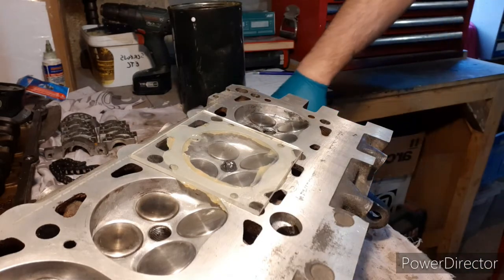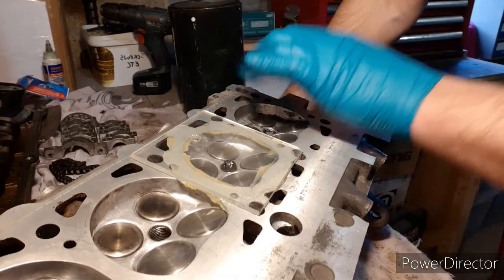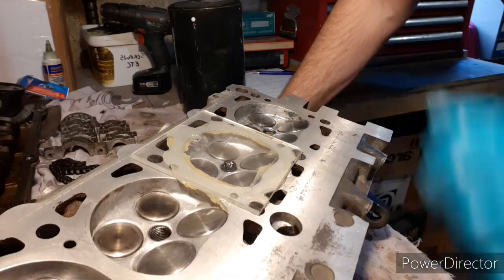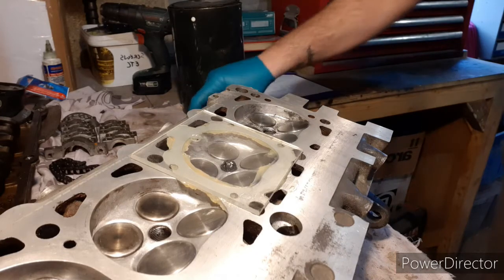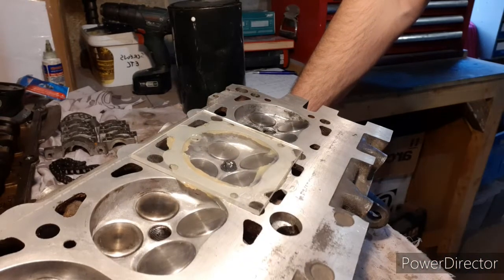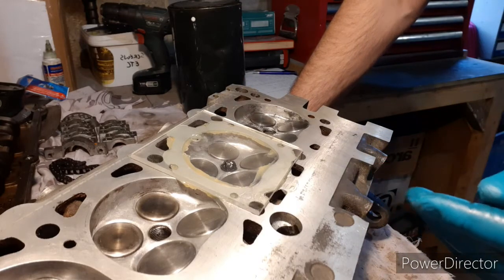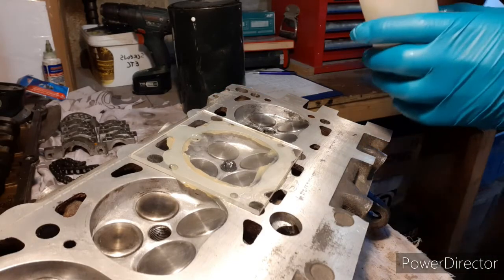That's now all sealed up. What we want to do now is put some fluid inside it. I've got the head at a slight angle with the spark plug hole at the highest point so that any air bubbles from the fluid can escape. I'm using some cleaning fluid with a bit of blue food colouring so I can see it — you can use screen wash which is easy enough. As a rule of thumb, 16 valve heads have a 45cc bowl size — cc is the same as millilitres — so I've got a bottle with exactly 45ml of fluid in it to fill that head up.